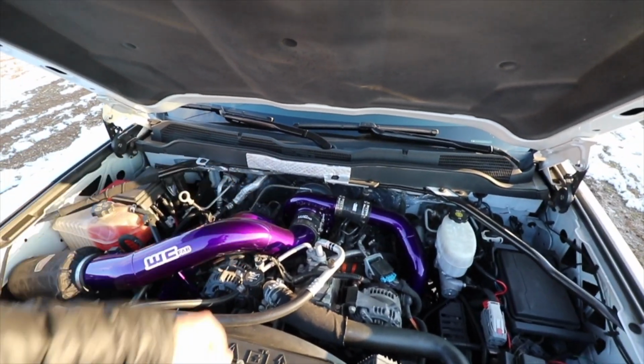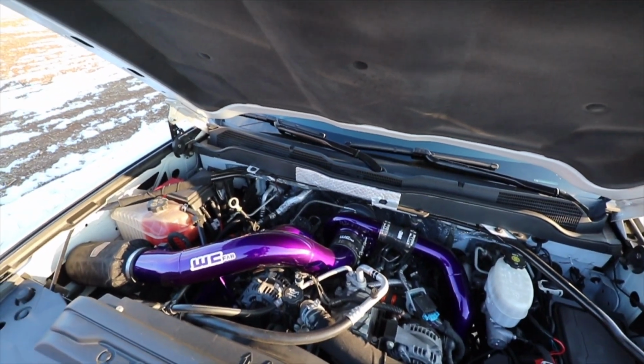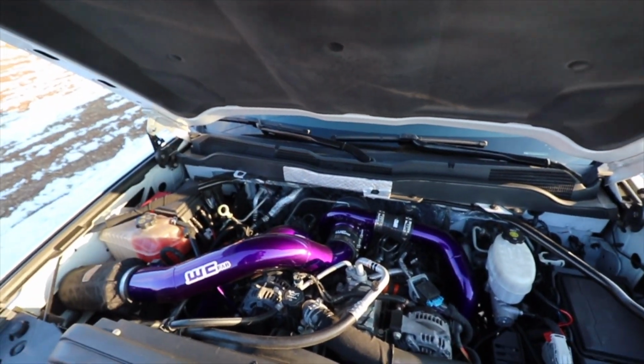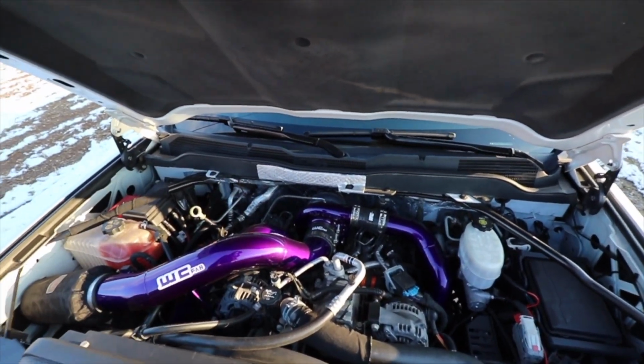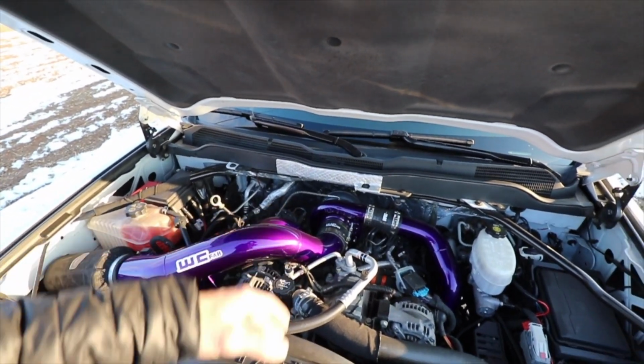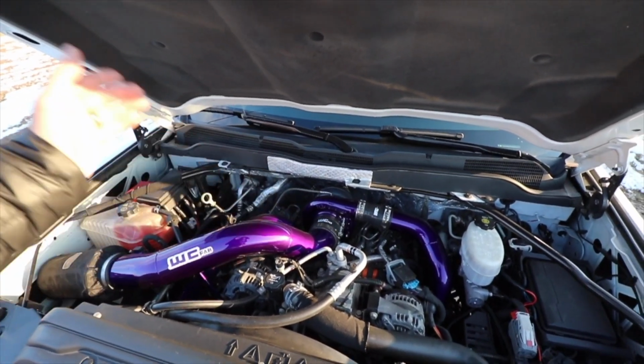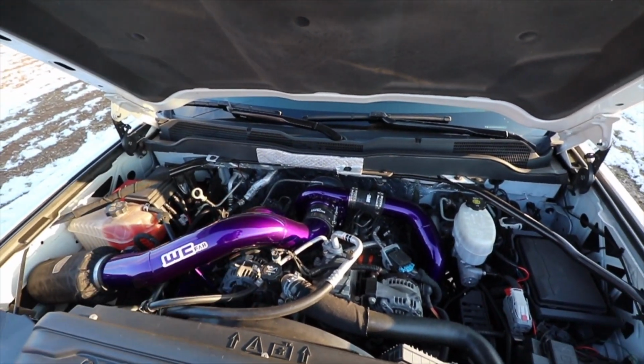So it's an S369 fixed vane turbo. It's the SXE model. I guess so, one of the newer S300 series. The S369 is the best of both worlds when it comes to the 300 or 400 series turbos. It's small enough that it spools relatively quickly, not a lot of lag, but it carries boost throughout the entire RPM spectrum. This thing pulls like an SOB.